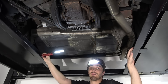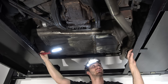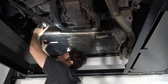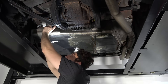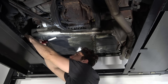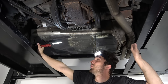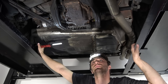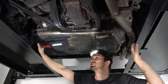I haven't shredded anything — I have quite literally had zero problems with this car, and that's astonishing. These cars are resilient — obviously no cracking in the frame. Maintenance I like to do every year, which I'm only not doing right now because I still have my first tank of gas from last season. Fuel filter and oil change — this fuel filter I did last year, but I think it's just good to do them every year when you've got a turbo car running E85. I'll get to that next time I'm under here. A fuel filter and an oil change, and she has been very happy for many years now. I'm pretty stoked to see how things are holding up.